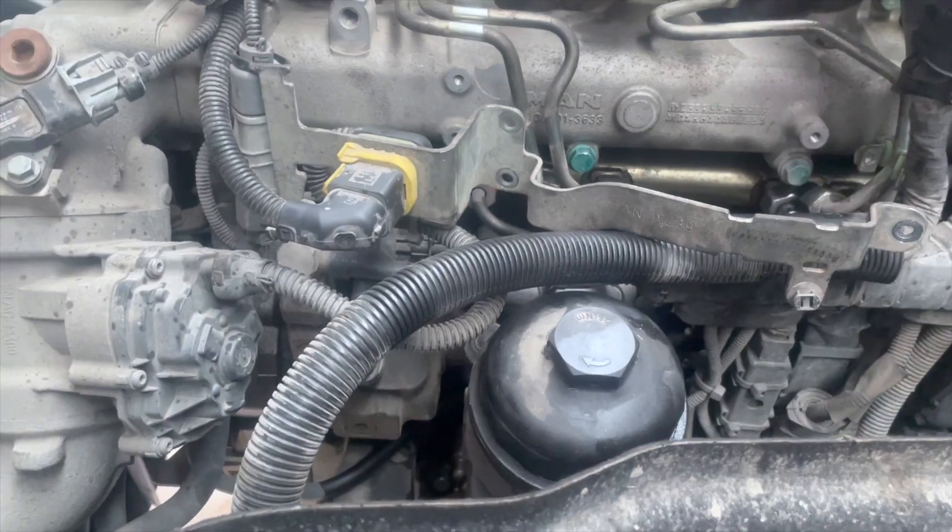I'll show you how bad it knocks in a minute. Looks like we have a problem internally, possibly in the head. Blocked all the injectors off and it was knocking quite bad — blanked the injectors off, did all that, still knocking quite bad. So now we're going to strip it down, get the head off, have a look, see if there's any damage. Sounds like something on one of the pistons, but who knows until we strip it. I'm looking forward to doing this — never stripped one of these engines before, so it's all going to be new. Let's get cracking and strip this down.